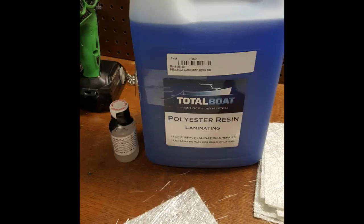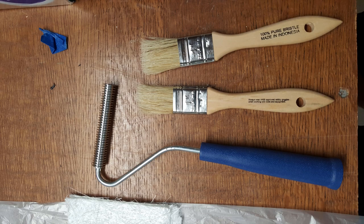We'll go over a few of the materials first. You're going to need fiberglass mat and polyester resin with the hardener agent it comes with. You're also going to need brushes and a fiberglass roller to make sure you get the bubbles out. Later on you're going to need some body putty spreaders, lightweight body filler, and something called Dyna glass, which is a fiberglass filler — essentially a body filler with fiberglass strands in it to make it stronger. You'll also need various sandpapers and a Dremel.